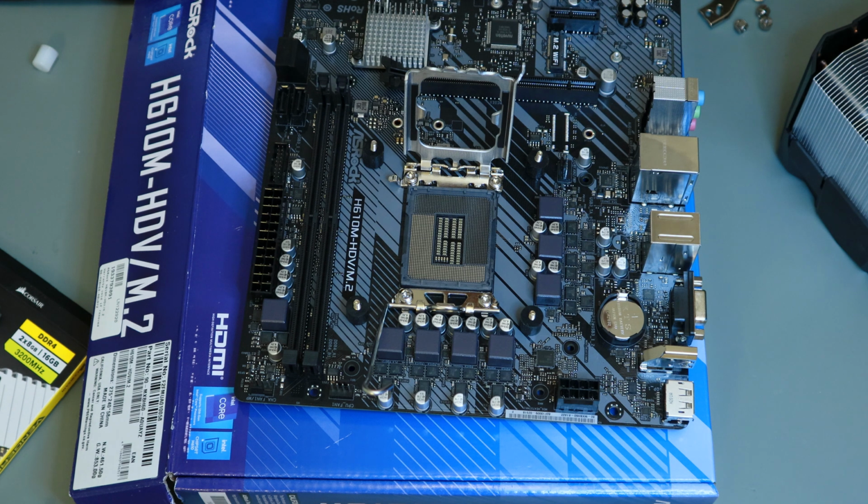Before you put your CPU in, you want to make sure that you haven't got any dodgy pins. If you have, RMA it and say you need to give me a new board because you sent me a damaged one. We're okay, no problem. Believe me, they are not solid rock hard things. I had a 1700 motherboard, an expensive one. I thought I'd put it on the side for a bit while I had my dinner, and for some bizarre reason it got pins damaged. I don't know what fell on it, but for some odd reason it was damaged.